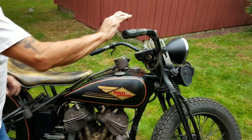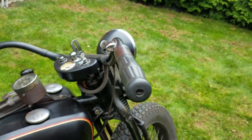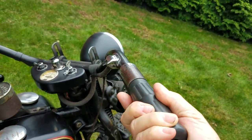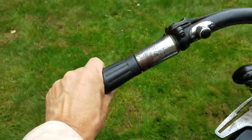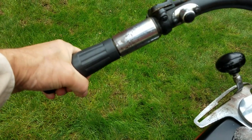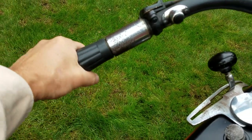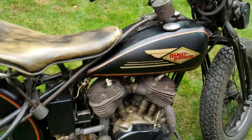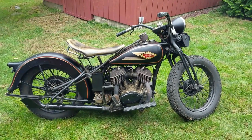So what Pete did is here on the right was the throttle. On the throttle, you can adjust just like a modern bike. Whereas on the other side, you have an ignition where you can — if you listen to the motor — we're going to retard it. You hear the motor smoothing out. We'll just bring it up. And there you have it: 1930, first year Harley VL, 74-inch flathead.